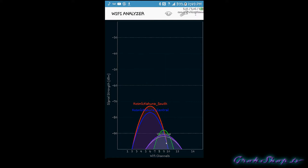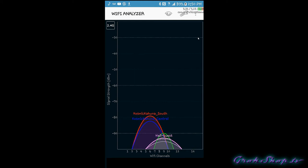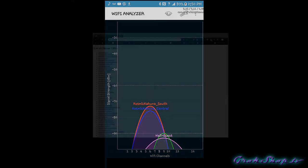This is just one side of my house — the other side has a lot more activity. You have to find a sweet spot with the least amount of overlap given the totality of interference. I live in an area with large properties so I don't have huge interference, but in apartments it could get pretty crazy. The 5 GHz view shows literally nobody in sight from this side of my house. Check it periodically because neighbors will change channels, you'll get new neighbors, and most people don't even know what channel they're on — so experiment and find a quiet channel if possible.